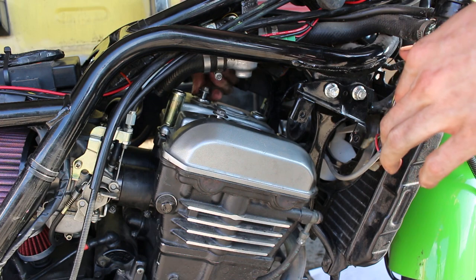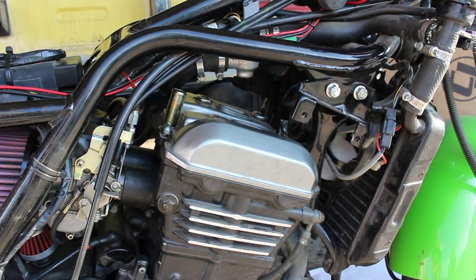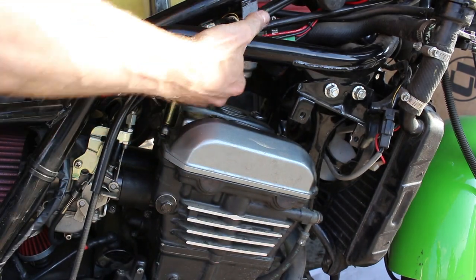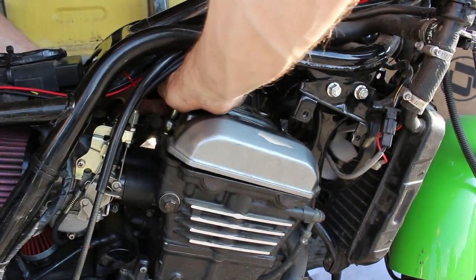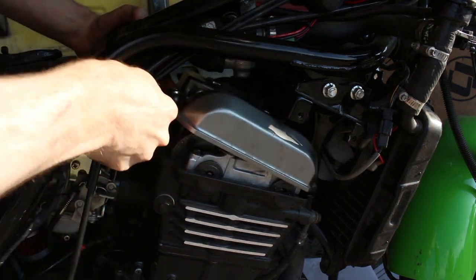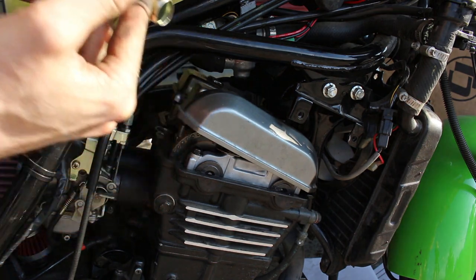Guy popped off. Next, I cleaned up any spilt coolant and proceeded to remove the head cover again. Next, there was a lot of working with that coolant fitting to get it to finally come off. I had to remove the top hose clamp as well and rotate the hose that connected to that coolant fitting. Alright, so I'm not sure if that did it, but I did have to turn it, and then she popped off. I think she just needs a little corrosion cleaning.